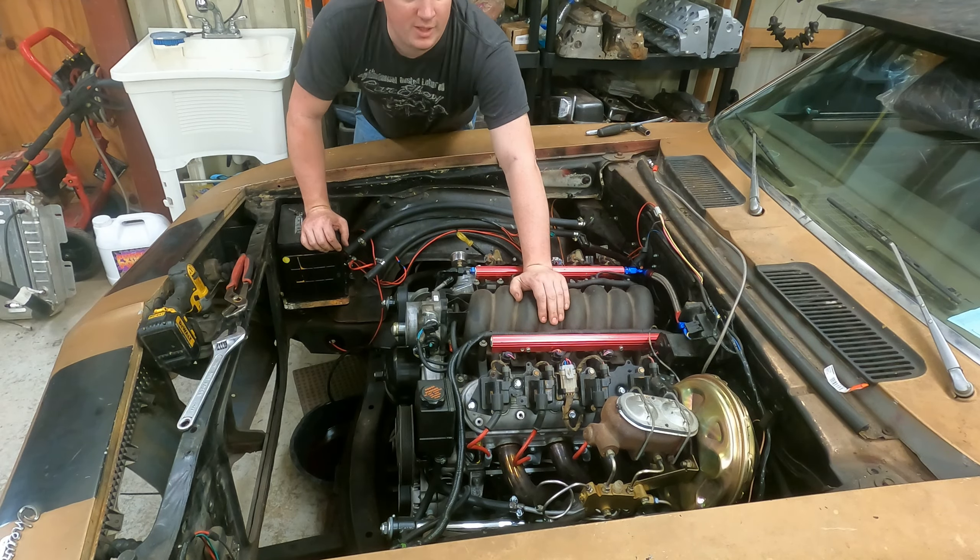As we lift, we're going to pull the driver side header out and take off the power lead. Motor bolt number one out, bolt number two out. The stupid jack keeps bleeding down — I need to bleed the air out of it. Here we go, lift off.